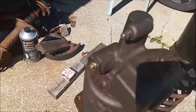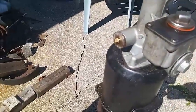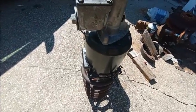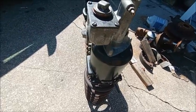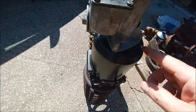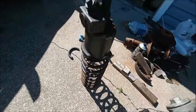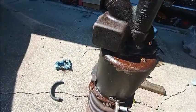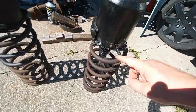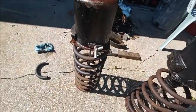They have similar looking outlets, although when you take them out, you'll find that they're not exactly the same. Another way they're different is the lubrication port is in a slightly different spot. This is the one on the Bendix. Let's turn this around to the sun. The one on the Bendix is rubber here, and the one on the Delco Moraine is a screw here. I don't know if that's how they were originally, but it's a slight difference now. There's only one screw for the vacuum pipes on the Bendix, and two on the Delco Moraine.